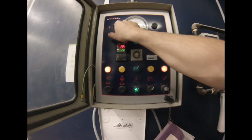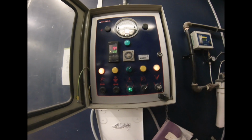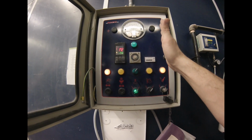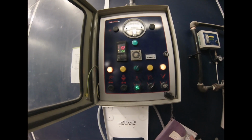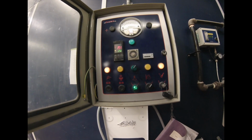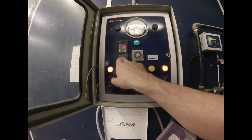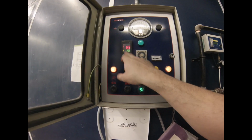And then when we open the door, there shouldn't be any air coming in or out. It's just static, or even for a safety measure, it's best to actually adjust it a little bit negative. So when you do open the door, nothing gets sucked in as you do it, right? The temperature adjustment is here. The burner hasn't come on yet. We'll hear it flame on in a few minutes.